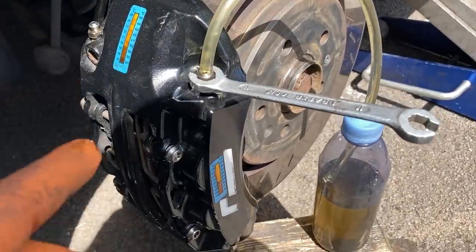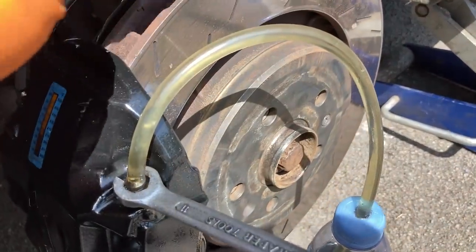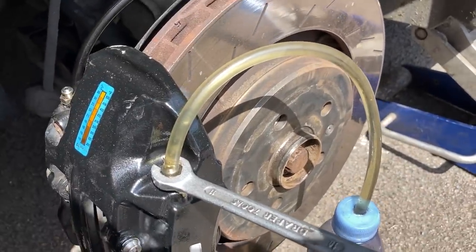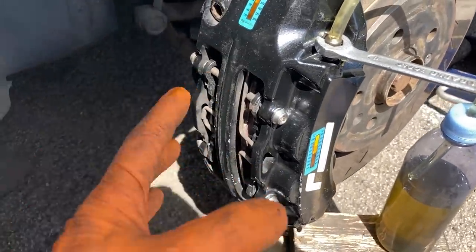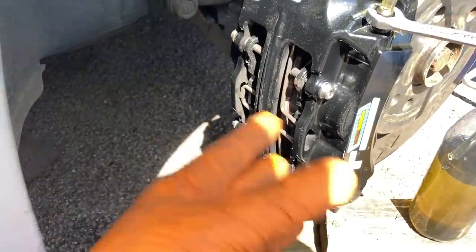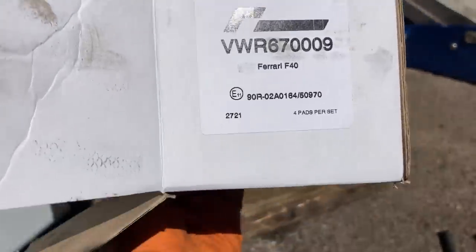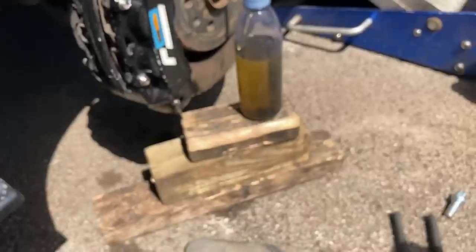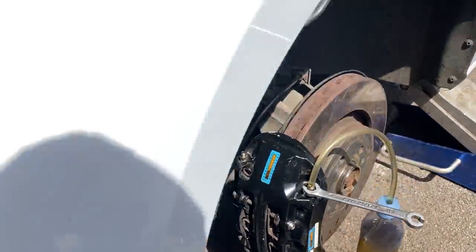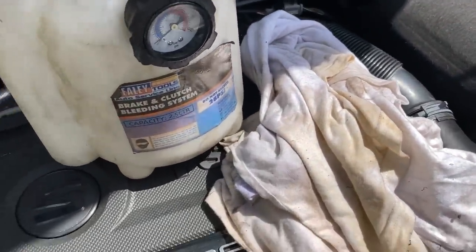While the brakes are bleeding, here's a closer look at the Racing Line Stage 2 Evo brake kit. The 345mm discs are handed correctly for whichever side of the car they're on — unlike the factory setups on TTRS, Sub-8, and Club Sport S, which are all wrong on one side and get very hot. We've got four-piston monoblock calipers machined from a single piece of aluminium. Some cheaper two-piece calipers can have leak issues. The pads are Ferrari F40 fitment — a common fitment available in many brands, not particularly exotic. Bleeding is done with a Sealy pressure bleeder, which has been very reliable.